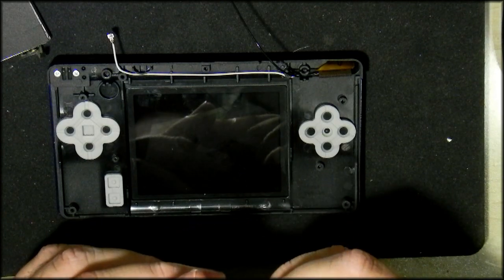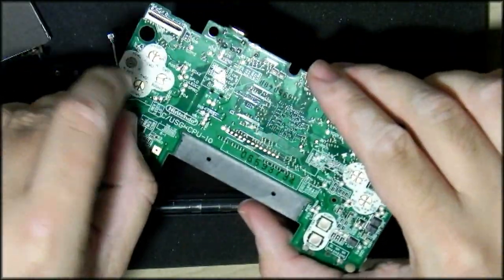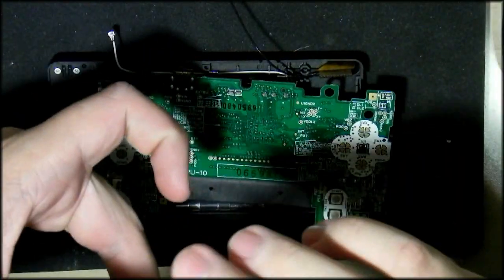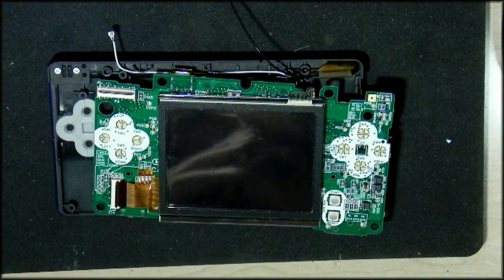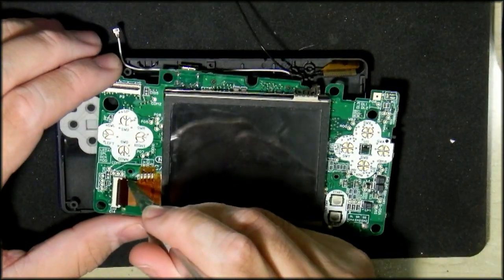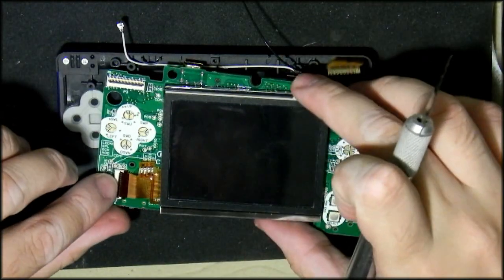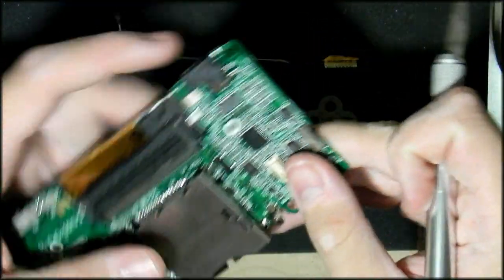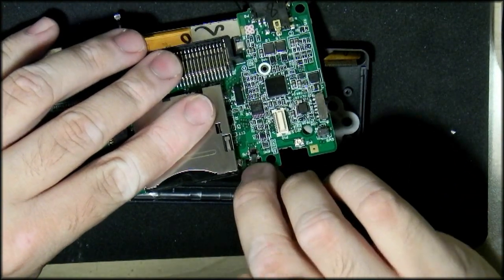Right, so got my board in hand. Going to take off that clip, this clip, just going to declip everything. Fits in the side. Now with the DSs, there's a little bit of a trap here. That looks like the ribbon cable is in. For most people it'll look like it, but you actually have to push it in until it clicks, like clips into place there. Now it's in. If you don't do that, then when you switch your machine on, it's not going to have power. It's going to flash the screens, and whichever screen isn't plugged in properly will get switched off.